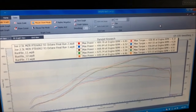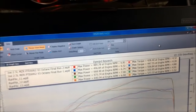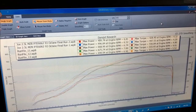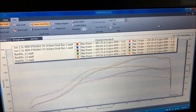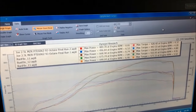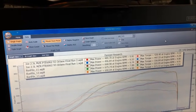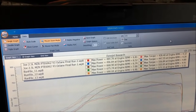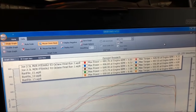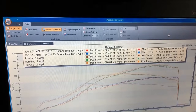But I really like this fuel pump. This TI-525 fuel pump is really neat. I'm probably going to go ahead and swap out my 450 for this pump just to have a little bit of extra headroom, just for sanity's sake. But yeah, this is the first 525 pump I've ever worked with on any type of car. So it's nice to see that even at 690 horsepower to the wheels, it's still holding pressure rock solid. And on one of the pulls, I had Joe record the fuel pressure. Unfortunately, I don't have a fuel pressure gauge to plug into the dyno's control module to log. If I did, I would, but I just went back to the old-fashioned throw a camera on the gauge, and it was holding rock solid, so that was cool. So I really like this fuel pump. I really like this setup. It's pretty badass, in my opinion.